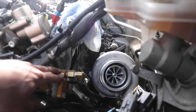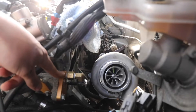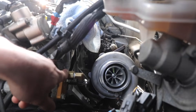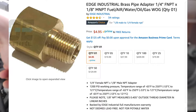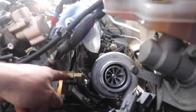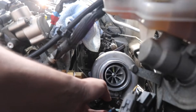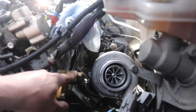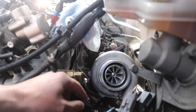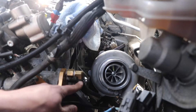You can get the hose at a parts store or wherever. Now for the coolant, starting on the EGR side — this is going to be supplying coolant to the turbo. I have the Damon Motorsports EGR delete and they use a 1/8-inch NPT fitting, but you need to go to a slightly larger hose. So what I did is I got a 1/8-inch male NPT to a 1/4-inch female NPT adapter. Then you want a 90-degree fitting because if it goes straight, you get a nasty bend and you don't want that — you want it as straight as possible with very little bend. After that, I got a 1/4-inch male NPT to a 1/2-inch hose barb. Just be aware it's outside diameter versus inside diameter — that messed me up a bit. Just make sure this is a half-inch barb.